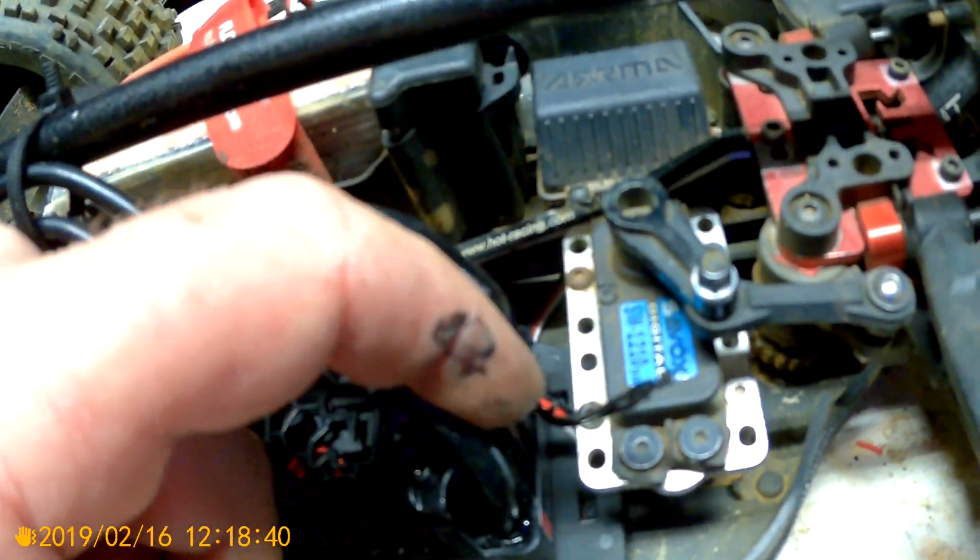So like I said, if you want to just keep your wire to program it, you can do it, but then you have to worry about your switch going around. So I'm just getting rid of it altogether because I'm tired of it. The switches work fine at first, but after a couple jumps they get looser and looser and looser, and next thing you know, they're always shutting off, and it's just irritating. So I'm going to have to mess with this one.